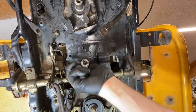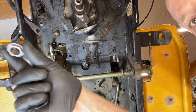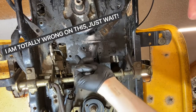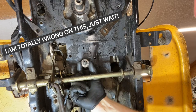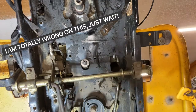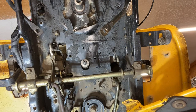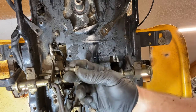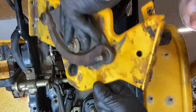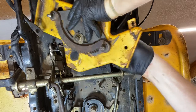We're back underneath here and we're going to install that plate. The easiest way to do it: first, take your new bushing and install that first — don't try to install the plate with the bushing. Push it up on there. Once we've got the new bushing on there, install the plate by pushing it up and just get a couple of those screws started. Be real slow with it — you've got these tie rods in the way, so just kind of push them back.